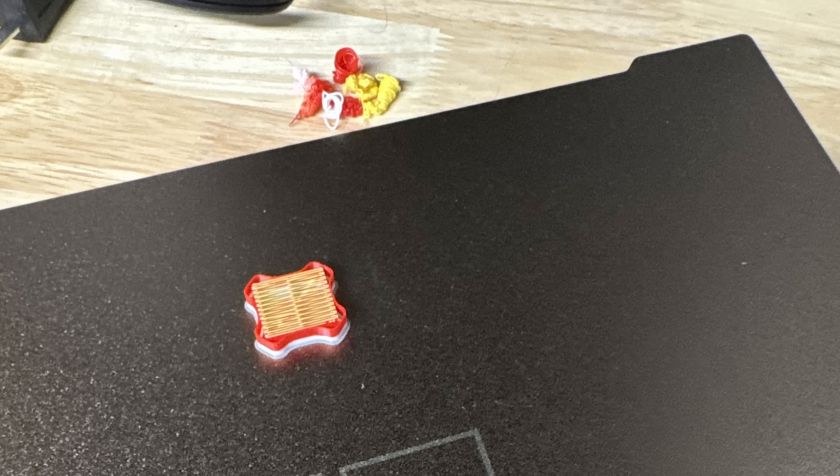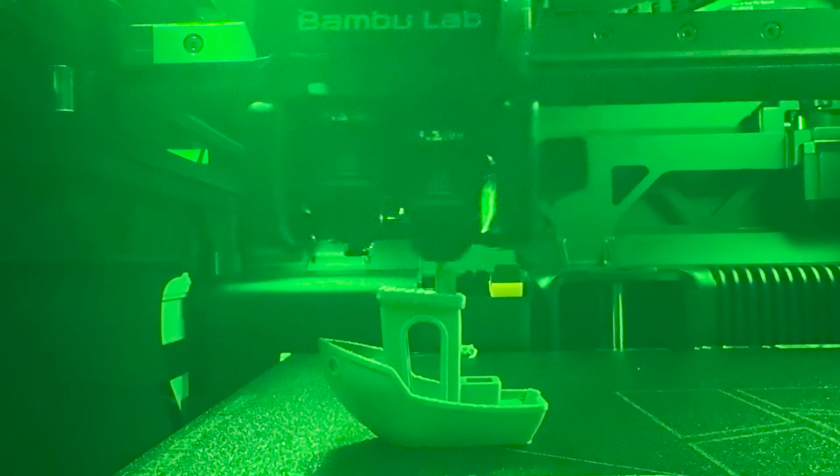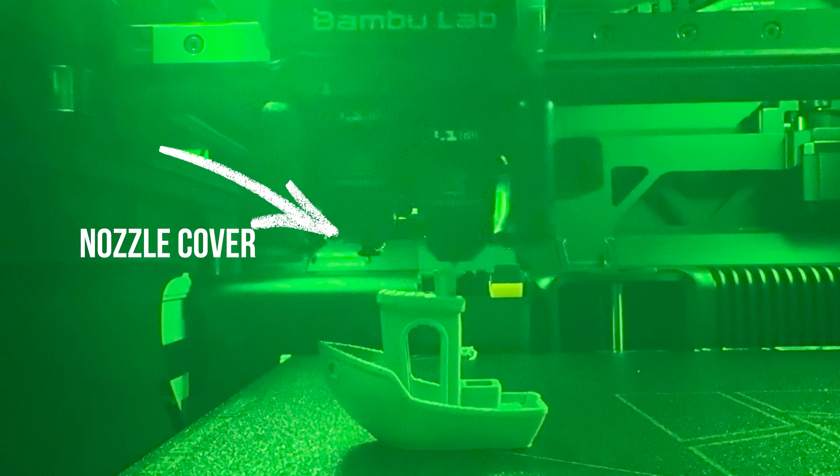That was one of the things about the X1 Carbon and multicolor prints that I didn't love — there was so much waste. Every time you needed to change colors, you needed to purge the nozzle, poop out a little bit of filament, then prime the nozzle again, creating a prime tower of extra filament that was never going to be used. The H2D does away with most of that. If you're using the proper modes, you can get that waste down to almost nil for a multi-color, multi-filament print. The way that dual nozzle extrusion system moves back and forth — it's a patented system — is really cool to watch. There's even a cover that goes over the nozzle not being used, so it's not spitting filament into your pristine print.